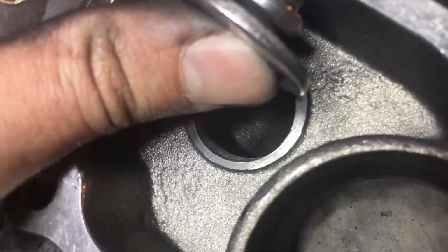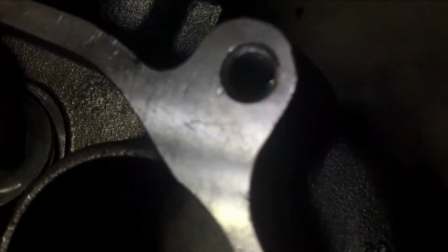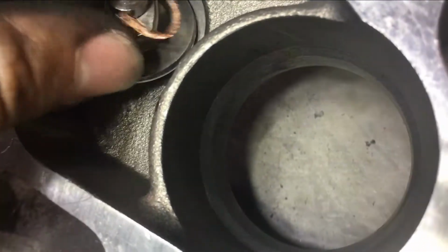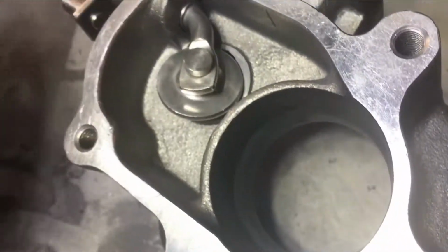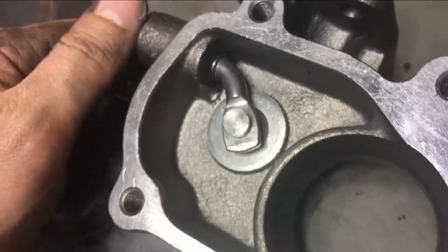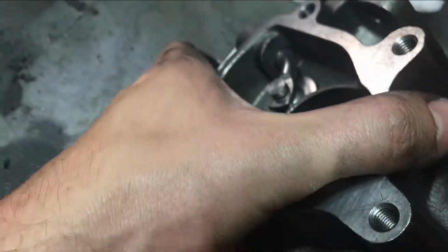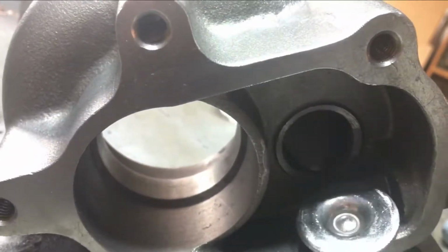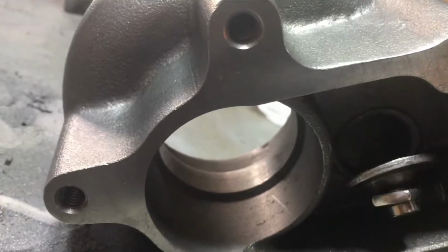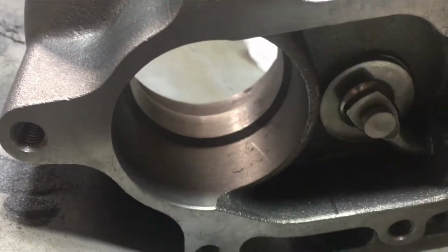And yes, me porting it a little bit had bigger consequences, but there's so much play in here that I think if we TIG weld it right there, just like I was kind of mimicking with this wire brush here, it will work fine. And it's so weird because it only works in certain areas. Like if the turbo is mounted the way it should be, like this, it's gonna give me problems closing. But if it's mounted, let's say this way, right? Look at this. Closes no problem.